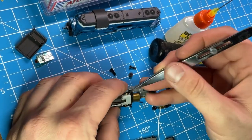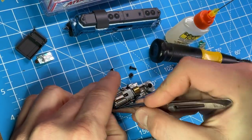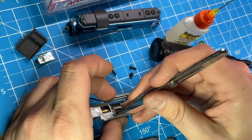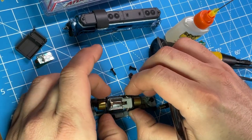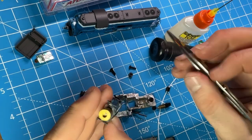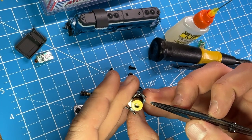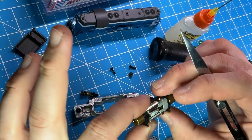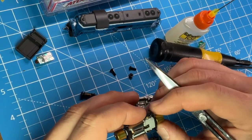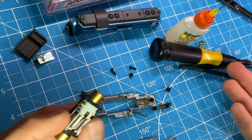I'm doing a full strip here. Pop this baby out. Because one side of the motor saddle is already out, she should come out pretty easily — just a little bit of love to get this end of the motor out. Now the motor saddle is out of the frame. One little tang is hanging on — press that one out from the backside. You don't want to wear out all the retaining clips. We broke this tang getting the motor saddle out — that's one out of eight. Just be careful. This thing has a natural spring to it and the pressure thereof will help retain it just fine. These things are not heavy duty — you've got to be careful. This is 10, 15, 20-year-old brittle plastic. Sometimes things will break.